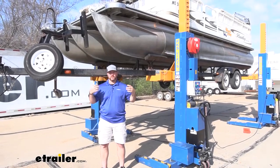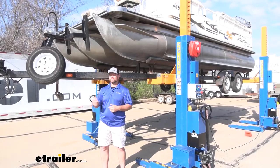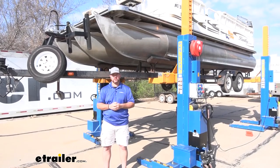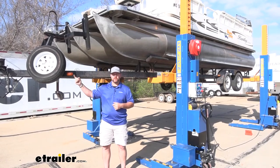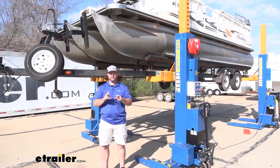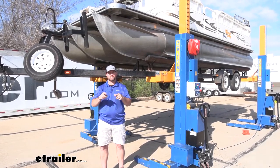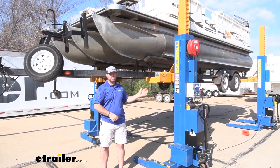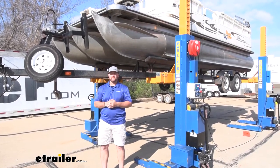Wires just getting old — as you can see, we have a boat trailer here. Getting it down in the water a lot of times, where they're connected will start to corrode. The wire will start to get hard and it'll start breaking really easy. This is a very easy way to rewire your trailer. It's going to give you a four-pole connection at the front and a yellow and brown wire and a green and brown wire. The reason they call it a wishbone is because they split that brown wire to where it goes down each frame rail to each taillight, making it very easy to connect your side marker lights and all of your lights in the back of your trailer without having to run it down one side and then across to the other.